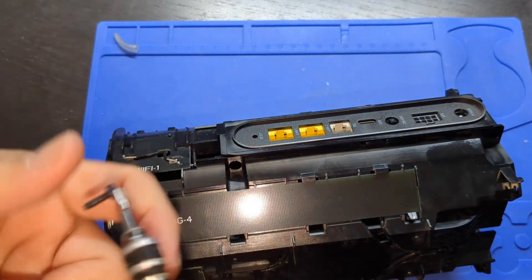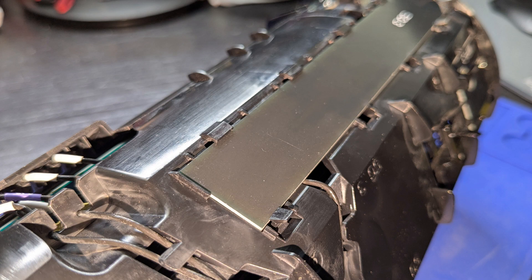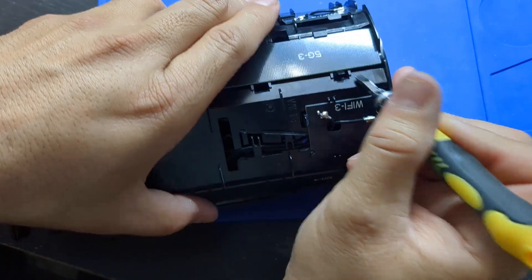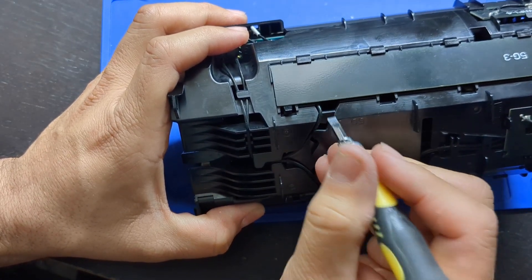We need to be careful removing the 5G antenna to get the fourth screw out. On this side, the antenna is tucked under a plastic edge. On the other side, you can press down and back on the clips to release the antenna. The two tabs to press are here — press the tab and lift the antenna carefully.